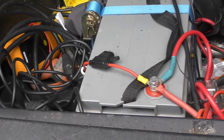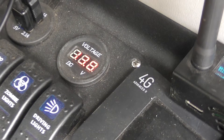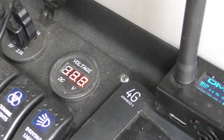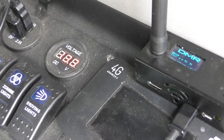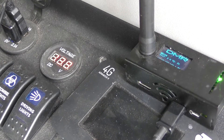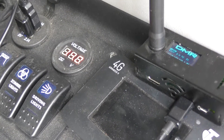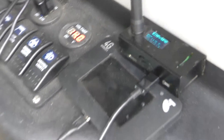Now we are going to have to move some stuff out from under here. In addition to being where the auxiliary battery is, this is where I store everything else basically. So I'm just going to remove some of this stuff. We'll go around the front, disconnect the battery so we're not sending any power back here. At the moment you can see we are — actually, it looks like we're getting 13.8 volts. So I must have scared it into action, because normally I don't see that higher voltage getting applied to the battery. 13.9 — that's really good, that's the best it's worked.